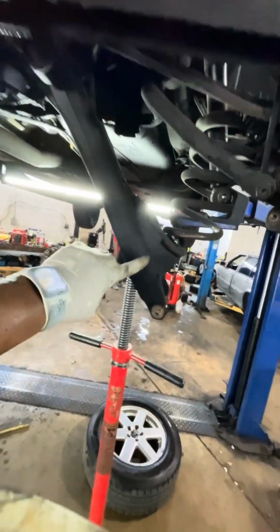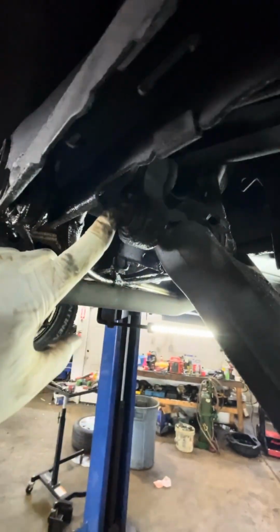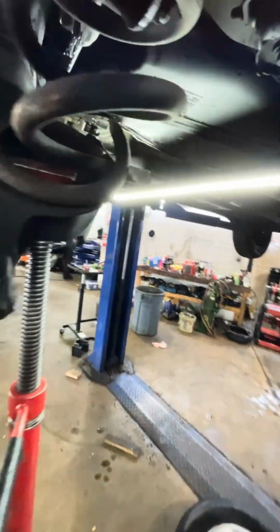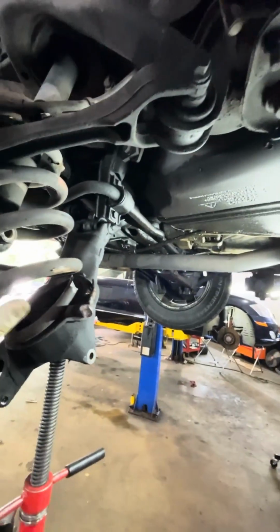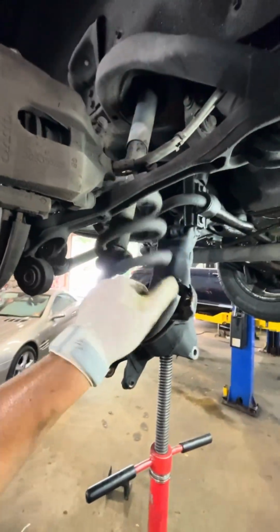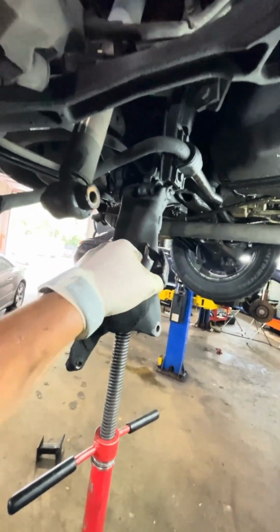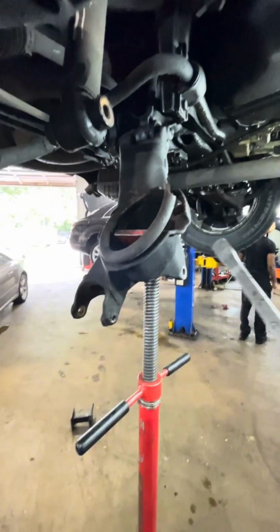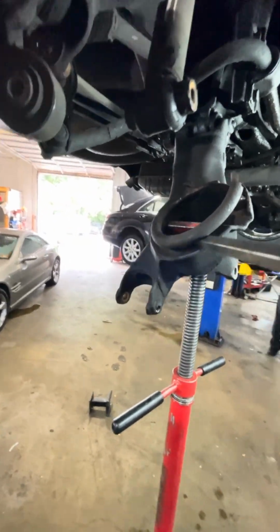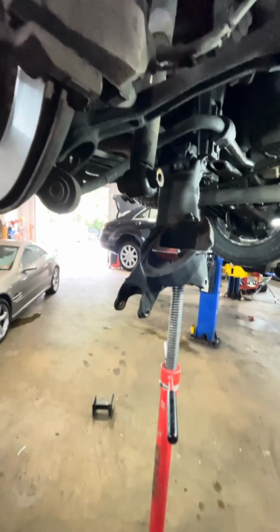Okay, just as I was saying, got the bolt loose, got the bolt out. Actually loosened up this bolt here to give me a little more play. We got the control arm down, separated from the shock, and I'm gonna twist this thing out, bring it down, that's out, and then the broke part. In the broke part, we're gonna pry out, and we're gonna install in reverse order.